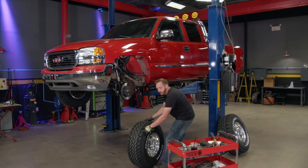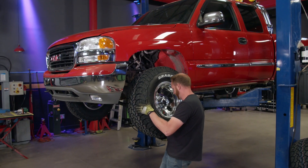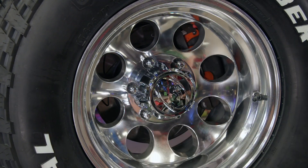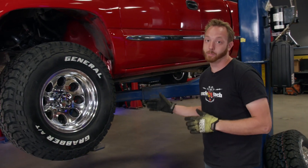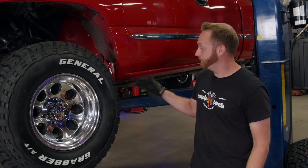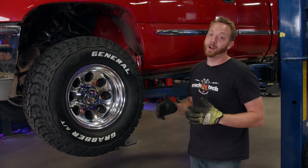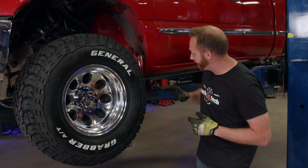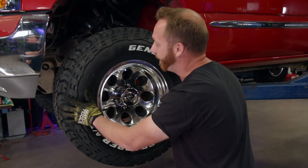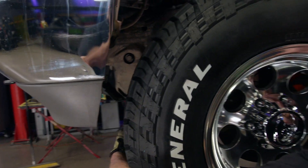This is the moment of truth — see if all this effort is worth it. It might seem a little bit drastic at first to have to cut into the sheet metal of your pickup just to fit a larger set of wheels and tires, but it is fairly common practice, especially on a GM truck, because the wheel wells are just pretty tight to the tire. One thing to keep in mind: you don't want to cut into the actual framework of your truck. Depending on what model you have, there might be some important structure back there. But on these GM trucks, it's just sheet metal, so there's no safety factor that we're taking away. With the suspension still drooped out, when we turn the wheel, you can see there is plenty of clearance on both the front as well as the back.